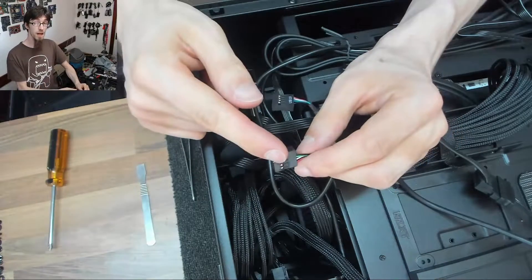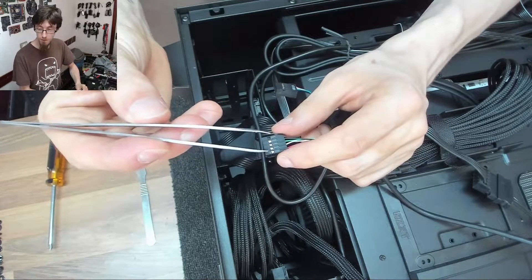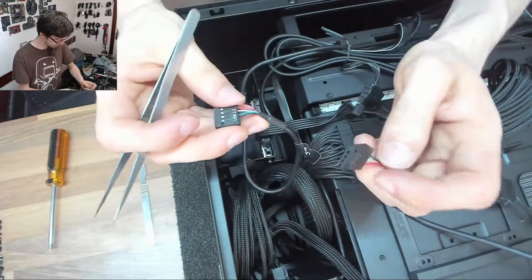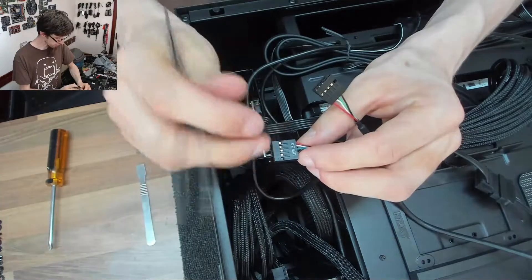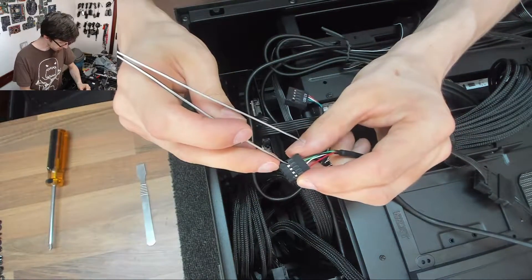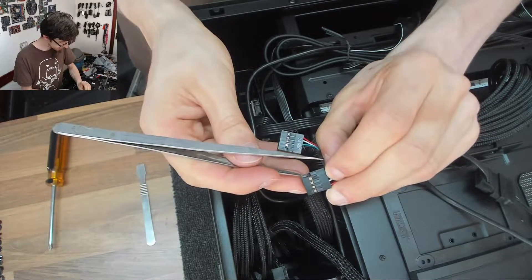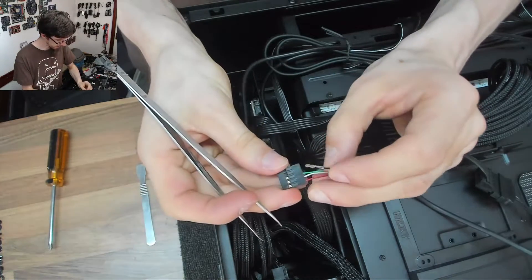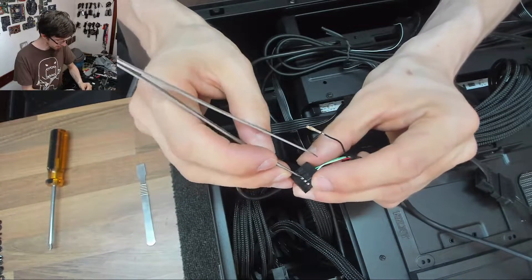So I can plug two devices into a single header. In order to do this you just need a fine pair of tweezers — that's it. I'm going to pick one cable; I'll pick this one because it's got a nice USB 2 print on it so it's easier to understand. For the other one, I'm going to get my tweezers into that gap and pry up the plastic tab so I can pull the pin out the back like that. We're going to repeat that for all of them until we've got four bare pins.